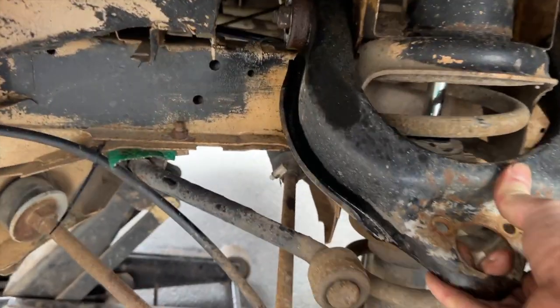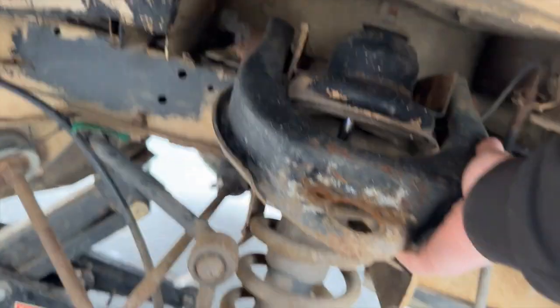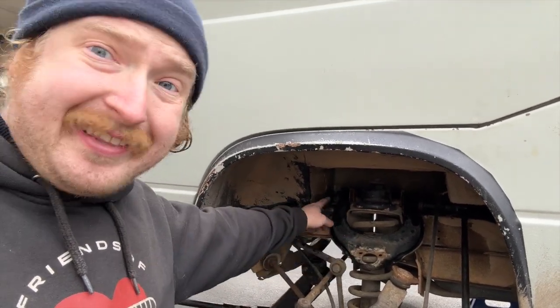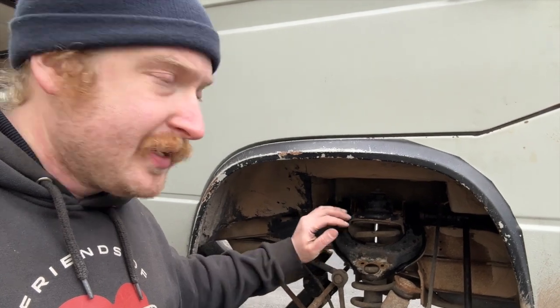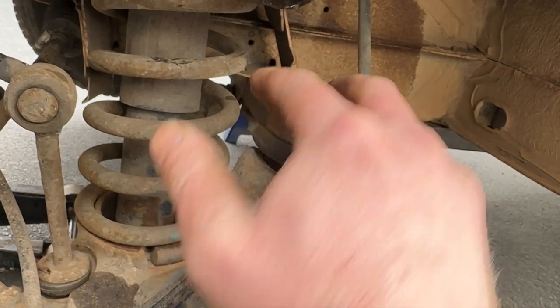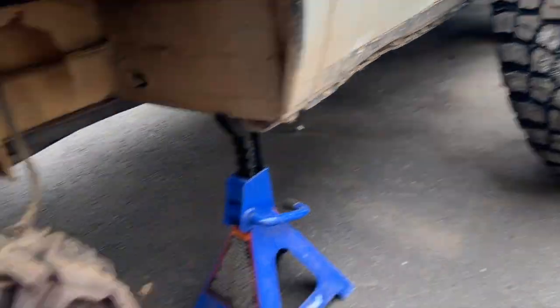The control arm should move very easily by hand, and it needs upper control arm bushings because it's supposed to move really easily — I would describe that as not that. The upper control arm does not move the way it should; it is bound up, the bolt doesn't spin right, and to get the nut off we're going to have to heat it, which is going to destroy the upper control arm bushing. So we need upper control arm bushings on both sides. That's also about as loose a ball joint as I've ever seen — it moves way too easily. And the speedo cable is not attached in the back, so that's an issue.